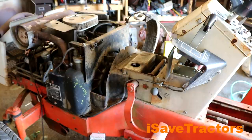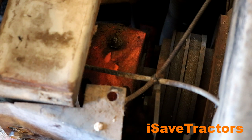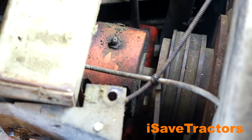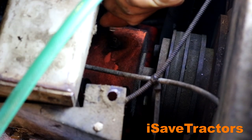Once that's out of the way, you can see the connection where the front of that PTO shaft meets the rear of the engine. That orange looking piece is a dust and dirt cover for a chain coupler. A chain coupler is where two hubs that sit around shafts come together and are held together with a roller chain — that's what's underneath that orange piece. I'm going to remove it so you can see it. The chain coupler is hooked onto a keyed shaft for the PTO shaft and then connected to the engine with two bolts. You can see the two bolts just to the right of that orange cover. Let's get the orange cover off and I'll show you what the rest of it looks like.